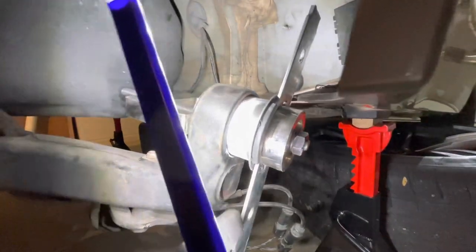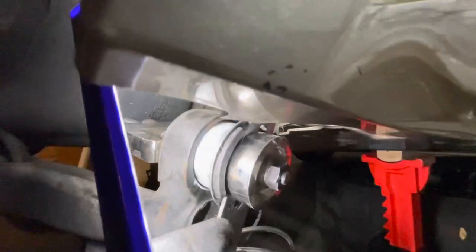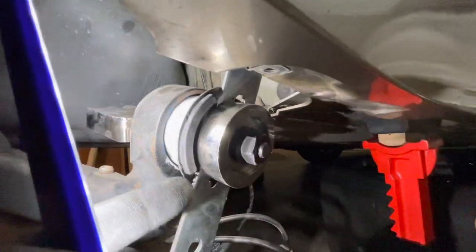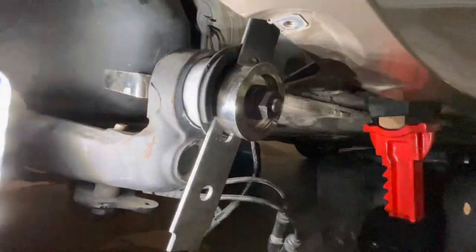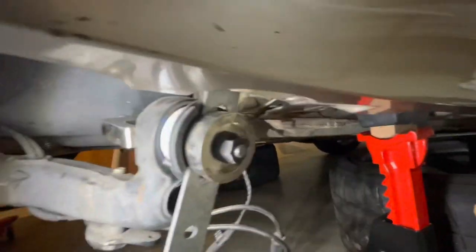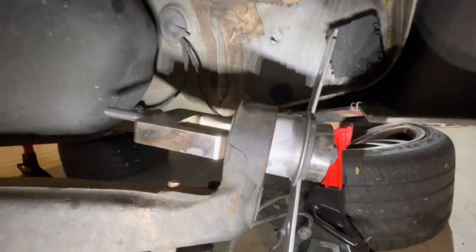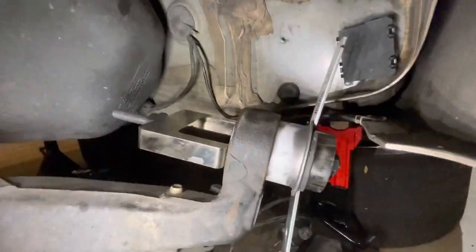So I've got these bits of scrap metal up in there to ensure that the force applied from here is exerted on that flange area. These are just single pieces that are wedged up in there. And now I will go ahead and tighten this nut here and pull the bush into place. I've made sure that it's pretty much in alignment. It's going to pull through square just by adjusting the position of the back piece.